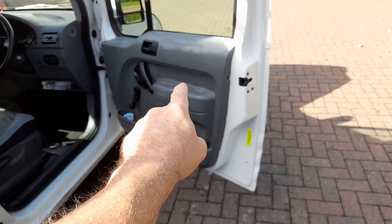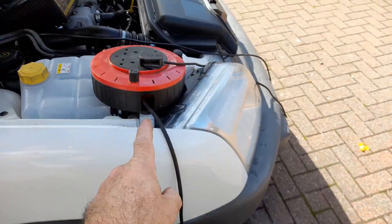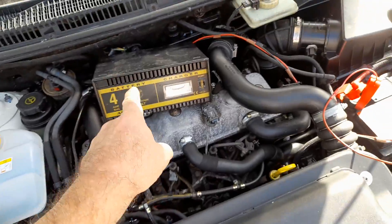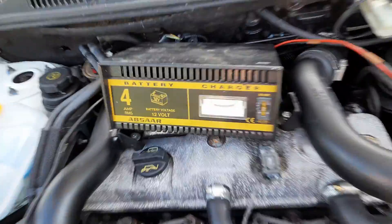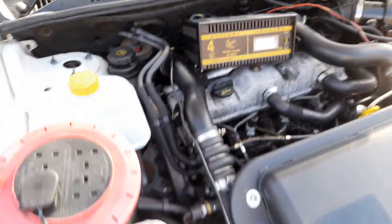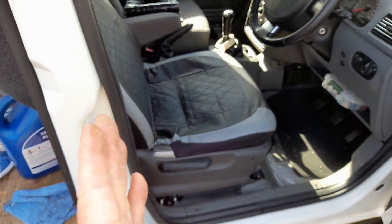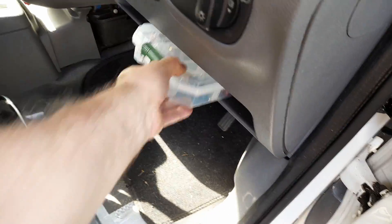Welcome back to the Ford Transit Connect. I'm getting there actually - I've got them there but didn't do any recording because I'm a bit weird like that. Right, let's follow the finger. Click, click, click - nothing. So lead extension charger, cooking at about three to four amperes - that shouldn't take long. As it draws current the current will go down, and as the battery fills current gets less, so when it's on zero it's had enough.